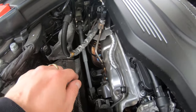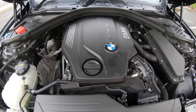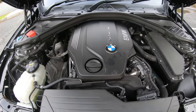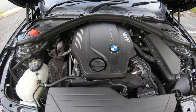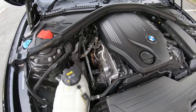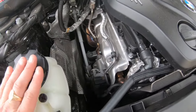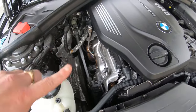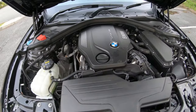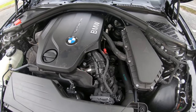These cars use thermal panels to heat the car up quickly, because diesels when cold cause a lot of carbon monoxide, especially in town driving. The thermal panels also help stop the DPF clogging up and get the engine up to running efficiency quicker than other cars. Since everything runs on electric, this car is going to be very expensive for people buying it in five or more years. You will not be able to check the wastegates manually - you'll need software like ISTA to diagnose all these actuators.